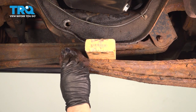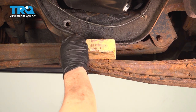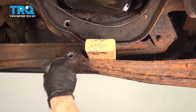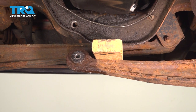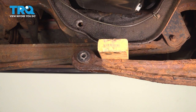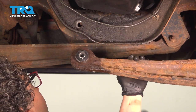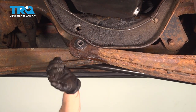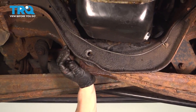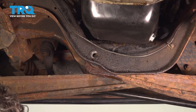This is what I do with every bushing even though it's the steel part — I always put a silicone paste in there. I learned this years ago from a front-end specialist and it helps prevent rust from inhibiting inside there and causing damage. Then I'm going to take out the 2x4, line it up, and get my pole jack to push it up the rest of the way.